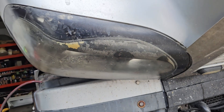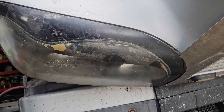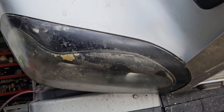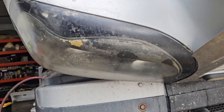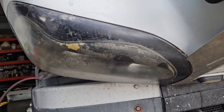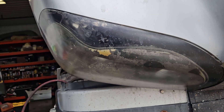If you're having the same problem, I'll show you how I did it. You've got to drill two small holes in each light — make sure you don't hit the sensor or get into the light itself. Just use Dawn liquid soap, and you're going to have to rinse it out. I probably did a gallon of water with the Dawn dish soap in each light, and then once it drained out, I kept adding clean water to flush it out.